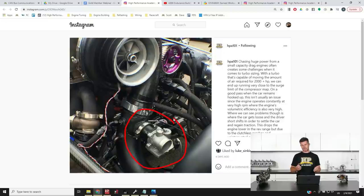The engine operates between about 9,500 and about 11,000 RPM as it goes down the drag strip, running very close to the turbo's surge limit. Where drag racing gets tricky is when the car's on a poorly prepared strip — if the car gets a little loose, a technique used to tame it down rather than lifting off the throttle is to short shift into a higher gear. With a clutchless gearbox, this drags engine RPM down further in the rev range but the boost pressure stays the same — the turbo doesn't drop off boost like a conventional manual transmission would. That combination of lower RPM with lower volumetric efficiency, coupled with high airflow from the turbo, can tip it over the edge into surge, which can be quite destructive at very high boost levels.